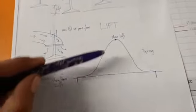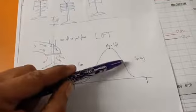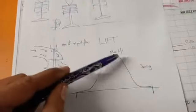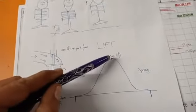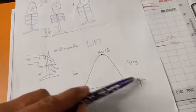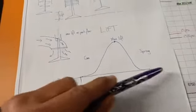Now, while it's opening, most of the force and the load here is on the cam lobe, and when we're closing, it's the spring that keeps the follower against the camshaft, and as the cam rotates, the valve basically starts to close and then gently lands in the valve seat and closes up. So that's basically our valve lift.